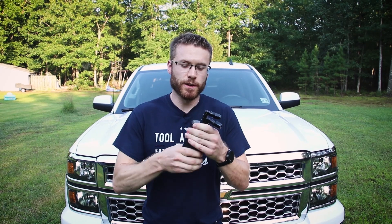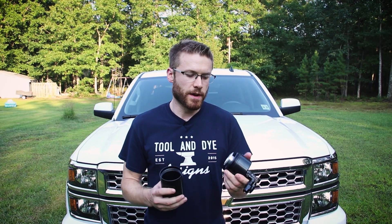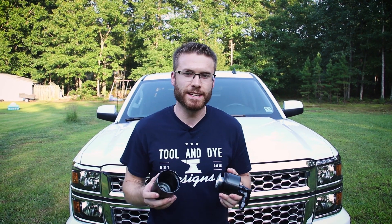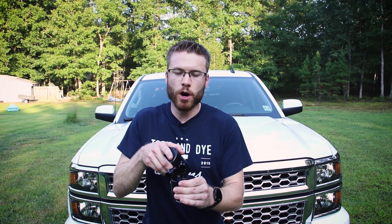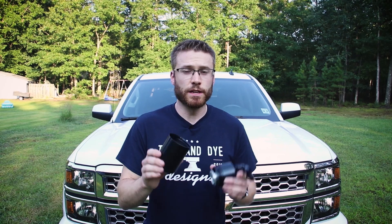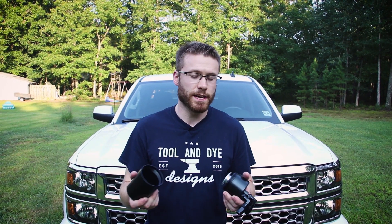Here's the catch can we're going to be installing today. It's got a removable reservoir where the oil will be collected. This is a three-chamber design catch can — we will have a link to the Elite Engineering article which fully describes and breaks that down in detail. The one I went with has a single outlet port; the center is the inlet, but you can also get one with a second outlet port. This is a fully billet aluminum design, anodized in black. It's only available in black, whereas the standard one is available in multiple colors — so that's one downside. But if you know a painter, they can easily paint this up any color you want.